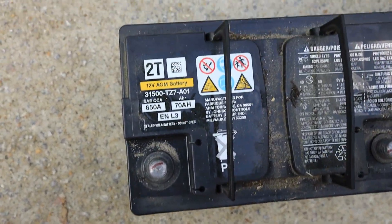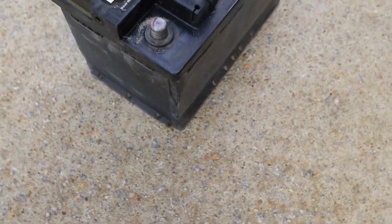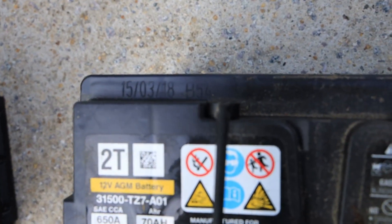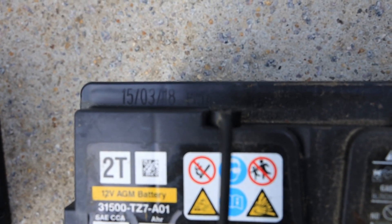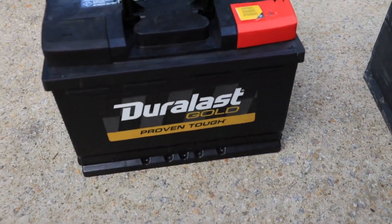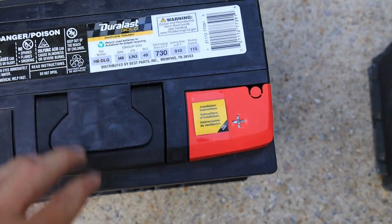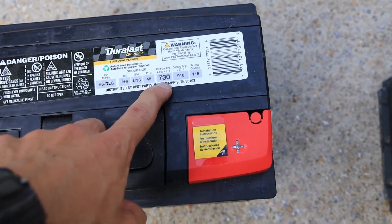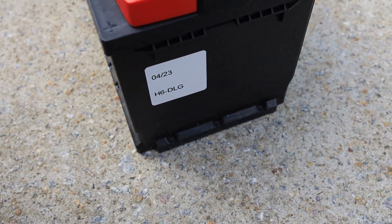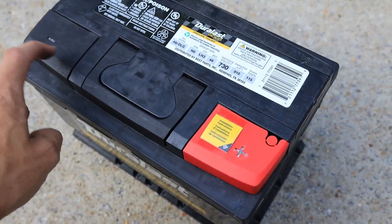Here is the factory battery — it is 650 cold cranking amps. I found the manufacture date: it says 315 of 18. This vehicle was purchased somewhere in June of 2018, so this is a pretty old battery. Here is the new battery I am putting in — it is a Duralast Gold. It comes with a three-year warranty and was right around $200. It is a group 48, H6, with 730 cold cranking amps. They put a sticker with the exact manufacture date of 4/23 — so it's from the first week of June, a pretty brand new battery. It even comes with nice little caps and a handle.